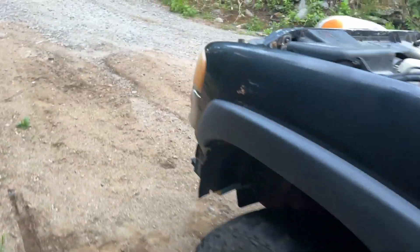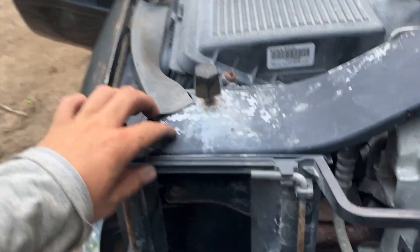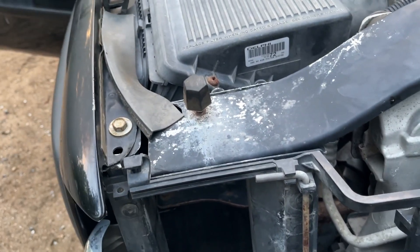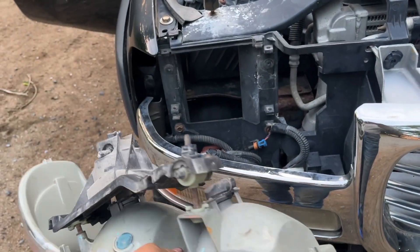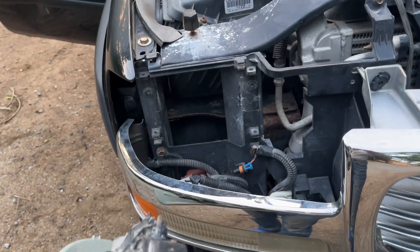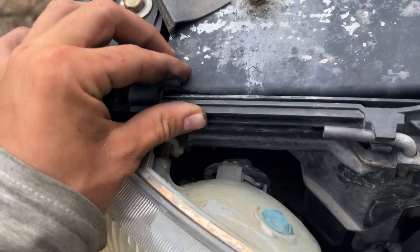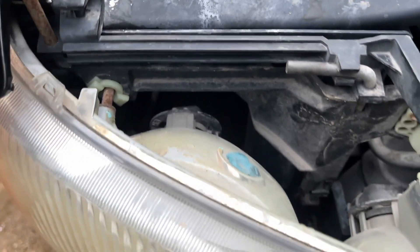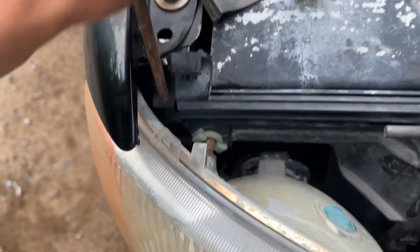It came with the headlights out, so what I'm working on right now is putting these headlights in. One of the reasons I love GMs and Chevys — it's literally this easy: pull these pins out, hook up your connectors, put the two connectors on and put those two pins back in. Phone died there and I put them on, but it's literally as easy as flicking this pin out, pushing that in, and pushing that pin back in.